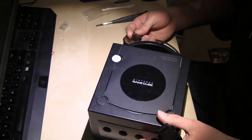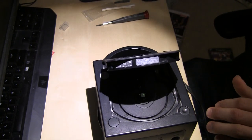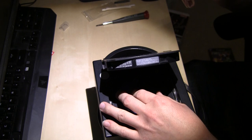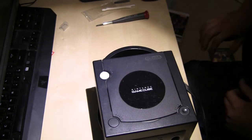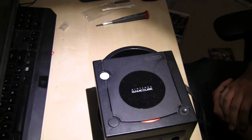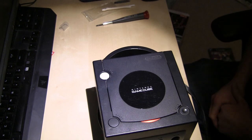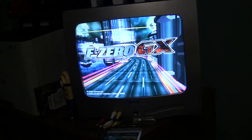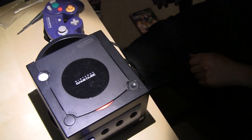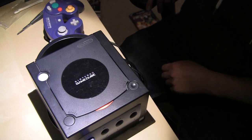Let's see if anything we did worked. Here goes — turn the TV on — moment of truth. It powers up and... it worked! If you've got a GameCube that won't read a disc, it looks like you just need to turn the voltage up a little bit on the laser. Cleaning everything also seems to have probably helped. I hope someone found that helpful, and thank you for watching — have a good night, goodbye!